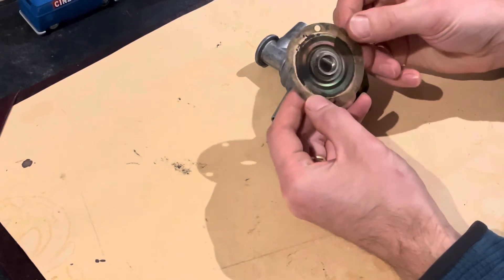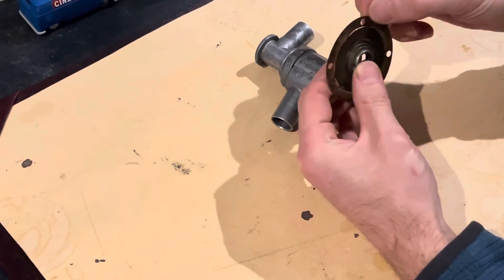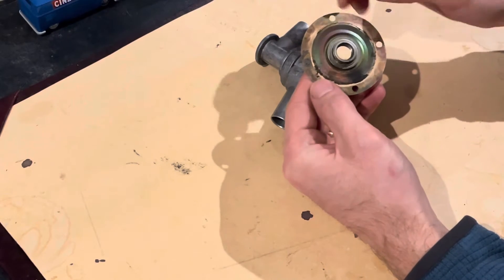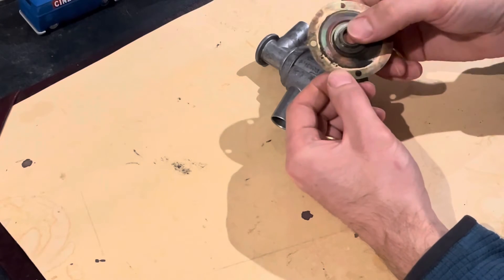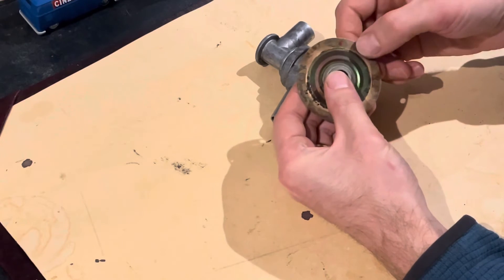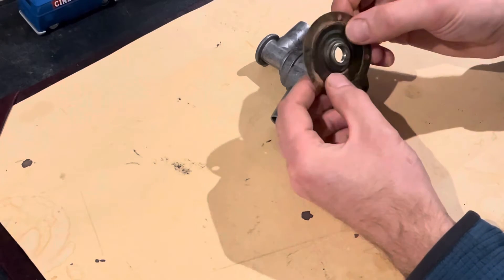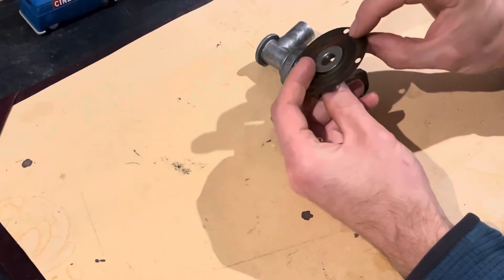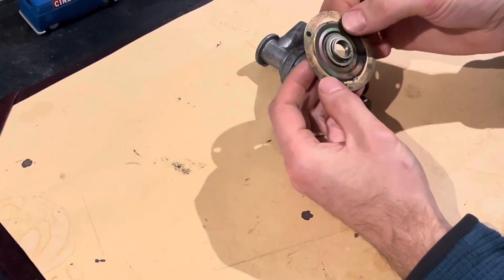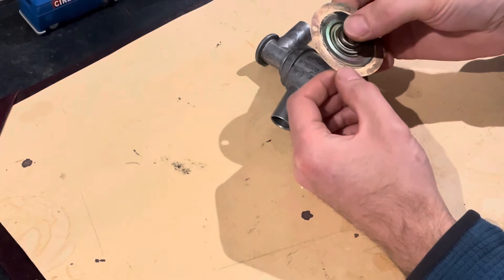This is the little metal diaphragm that sits inside the manifold air pressure sensor. As you can see, this one has split at least a quarter of the way around the edge — it's obviously not going to accurately measure vacuum in that condition. It's split there as well. Given how wafer-thin that surface is, it is inevitable that it will eventually succumb to metal fatigue and break — it's just a guaranteed failure point on the D-Jet cars.